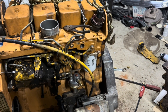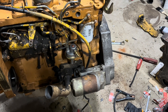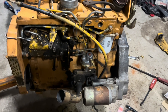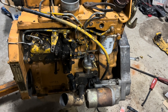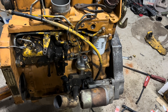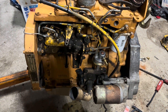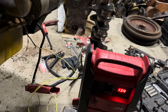After finding out that starter wouldn't turn the engine, I went ahead and swapped the block adapter, robbed the flywheel and the starter off the p-pump engine, which only fits if I leave this filler neck breather thingy loose — but I could modify it. I'll probably end up deleting it anyway. It's convenient that parts off the 12-valve fit. It's also annoying because I need accessories for three engines and I have enough for one.